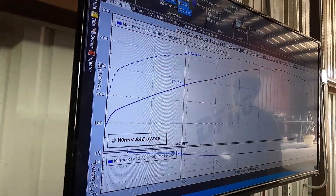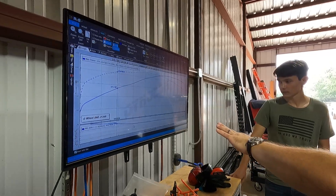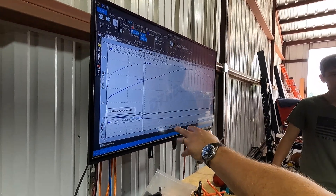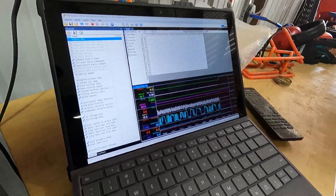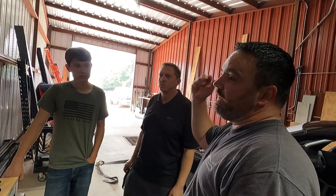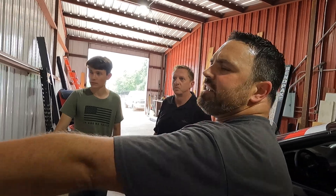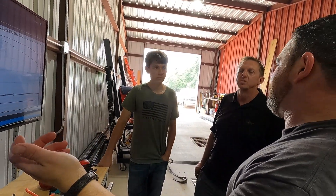This part of his map we need to adjust. In his tune, that target looks great — that's safe, it's coming to power. But here, you can actually hear it when I start with this guy. It's not enough fuel for it to really complete that burn — it could actually be pre-igniting. Looking at the log, that could cause it to ping or knock, which is destructive in the engine. This engine has sensors for that, and it's got a bunch of knock in there — the computer is actually going to pull ignition timing to try and save itself. There's something simple: the way these ECUs work, this actually could be a time delay. For emissions reasons, they built a time delay in there — so you floor it and it waits a while to give you the fuel. The tuner could have just forgot to delete that, because if you floor it, it should go right to your target. So hopefully that's all it is and we can fix it.